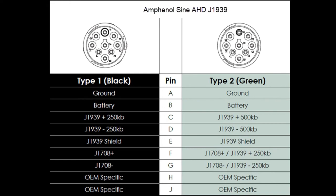No matter what communication device you're using, it's important to keep the firmware updated and make sure you use only the cables that ship with that product. That's because some of the cables have a smart chip in them where they plug into the device — that tells the device whether it's a JPro or a Nexiq, and it tells that device what the communication speed is going to be. Thanks for joining me, see you next time on Neural Splendor.